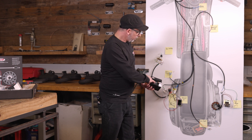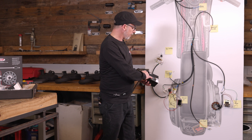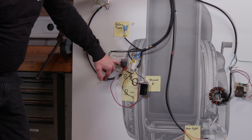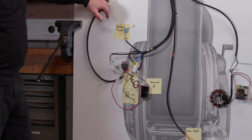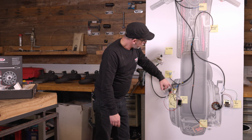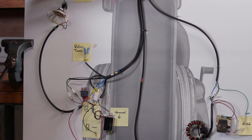For all models we can use the small scooter battery, which is perfectly adequate for most vehicles. From the battery, the fuse goes to the ignition lock, which goes through to the yellow wire and then through the blue wires into the wiring harness, where it is distributed to the brake light, horn, and light switch.